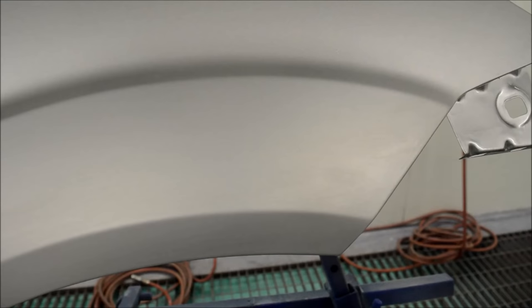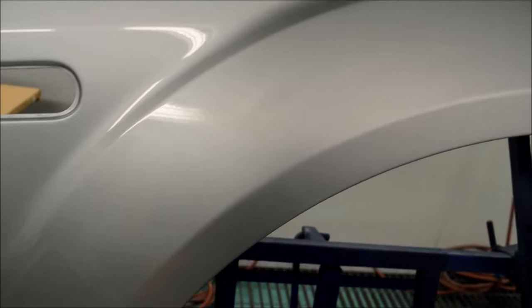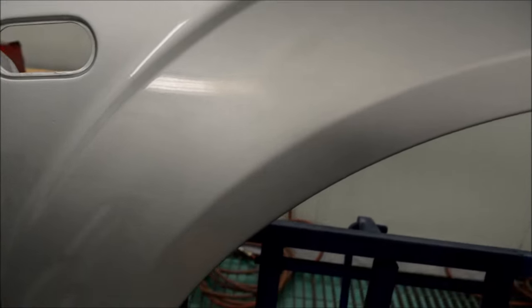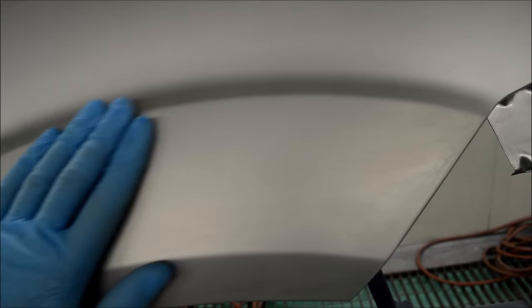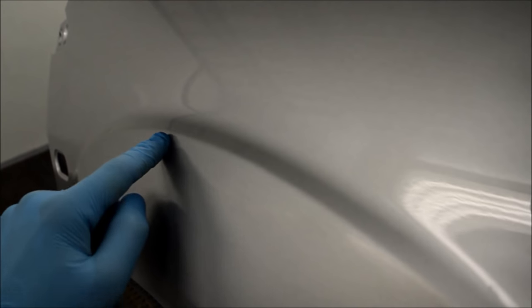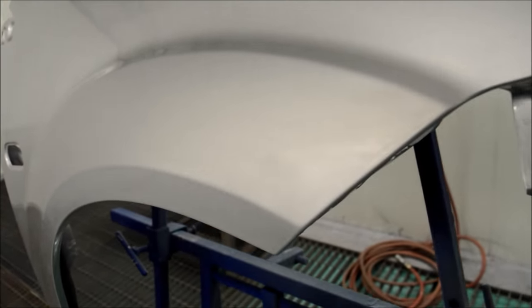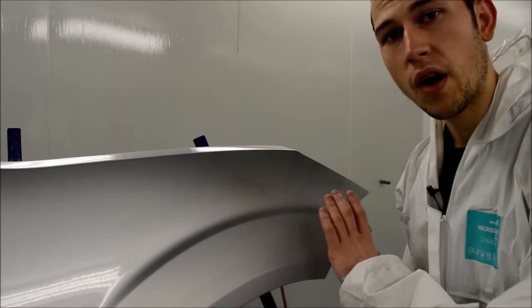Here's our area that we've scotched — you can see it's really nice and matte, and you can see where I've started to fade it out with the scotch pad, so that's probably where we'll end our fade out. This is all nicely and thoroughly scotched, and I've also made sure I've scotched right along this edge here — you can see just in that shadow — that's where we're going to put our tape, right the way down.